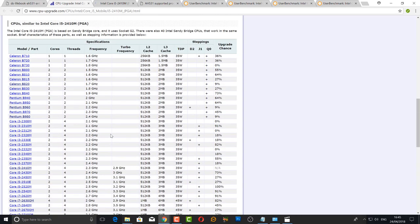The important part when upgrading your CPU is the TDP for the processor and also the BIOS. There are different models so you want to check the website for that particular brand — for instance Fujitsu or Dell. Go to their forums and check what chipset they're using and whether it's going to accept that CPU, and also whether the BIOS will accept it.